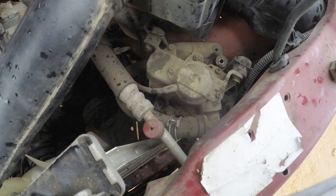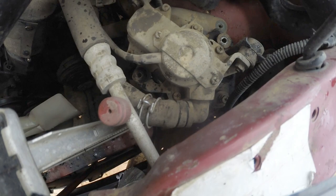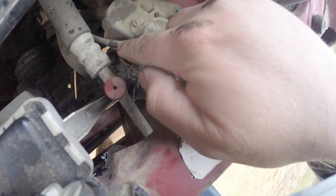All right, folks, so it was just the three bolts on the bottom. I thought this bolt here hooked up to this air box, but it doesn't. So I got three bolts out. We got two big hoses, and then we've got this vacuum line, which plugs in over here. Let's see if we can see that down where that blue thingamajigger's at.